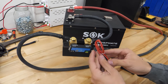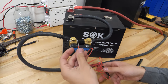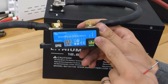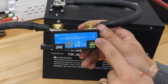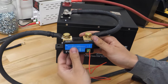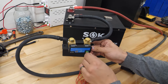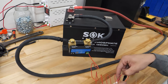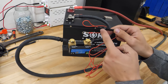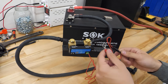Now we just have this little wire here. Go ahead and open that up. We're going to take this end that has the little terminal and insert it here on the shunt where it shows VBAT+. It just shoves in there — it's a one-way type deal so you can't pull it out, which is nice and strong. Then from there, the other end has a ring that's going to go on the positive battery terminal. This little black piece right here is a fuse, so you won't have to add one of your own.